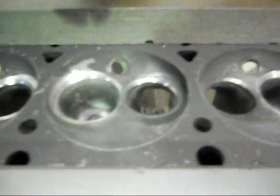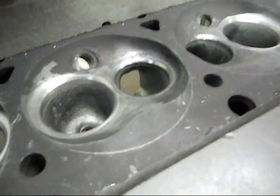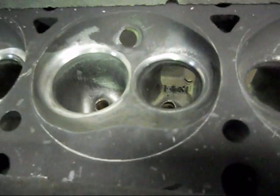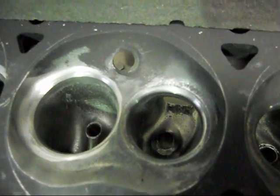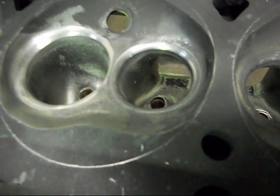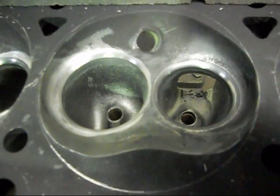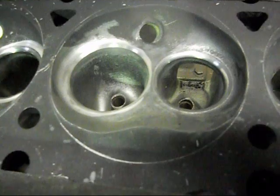One of the last tips we've got. I've had the cylinder head off the machine and I've painted black all over the face of the head. I've had a head gasket, lined it up with the dowels in the head and traced around the outside of the actual bore diameter of the gasket, which gives us our exact centralisation of the cylinder.